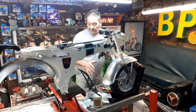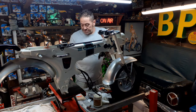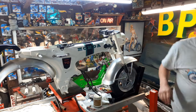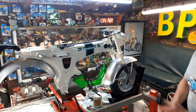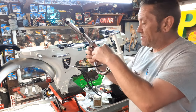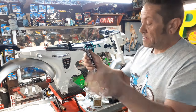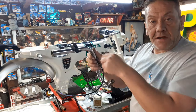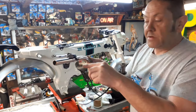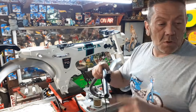So the front wheel is in. Tonight we've got to put a few parts on, so if I start at the front I'll put the bars back on. I've already gone ahead and put the switches on — again pretty straightforward, all you've got to do is just feed the wires through the bars. What I tend to do is tape up the ends of the wires and then literally feed them through and hook them through. I've got new rubbers on where the wiring goes through.